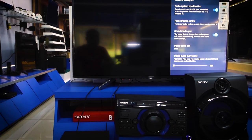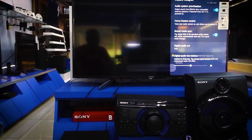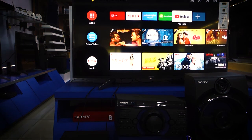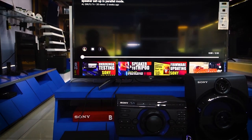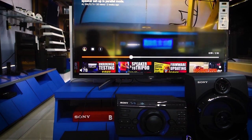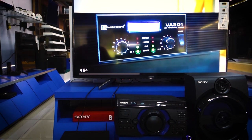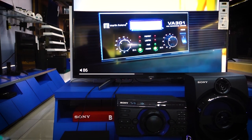So in the audio output volume settings, the middle option — the audio output volume — was set to zero. So if your TV has this option, you need to increase the volume to generate an audio signal. Now, going back to YouTube — there it is, it's working! The Importi M40 is now working.